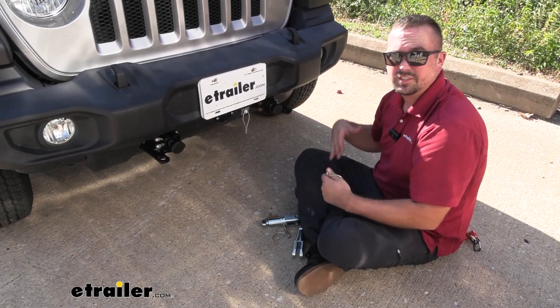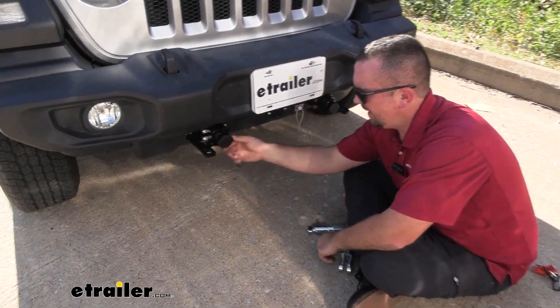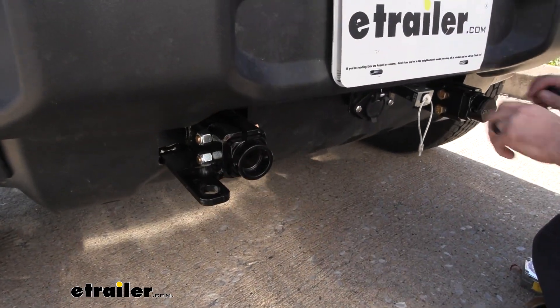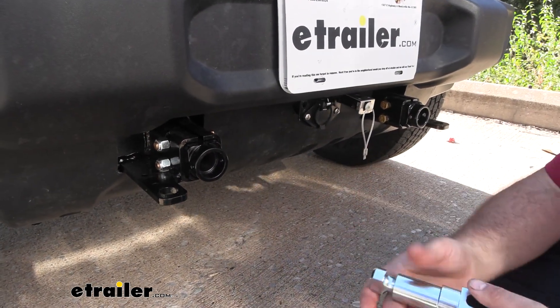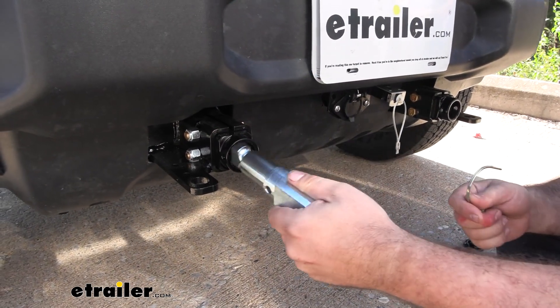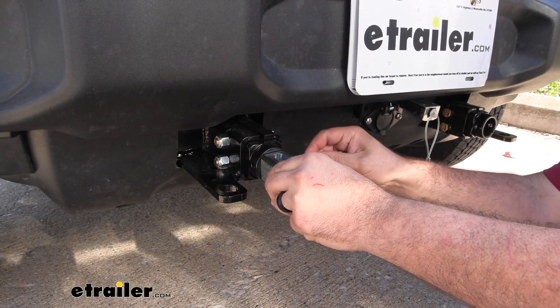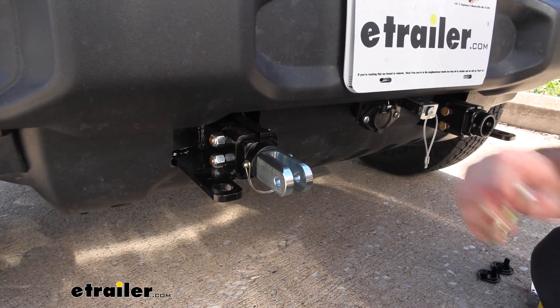While it has a pretty clean look when just driving around town, when you are ready to flat tow you can remove your plastic caps — a nice little feature that keeps moisture and debris from building up and rusting the hardware, since this lives on the front of the vehicle. You then just take your arms, slide them into place, give it a quarter turn, get your linchpin in place, and now you have your mounting tab for your tow bar.